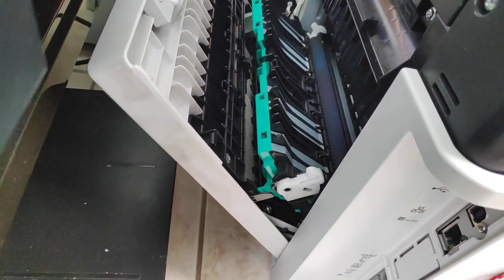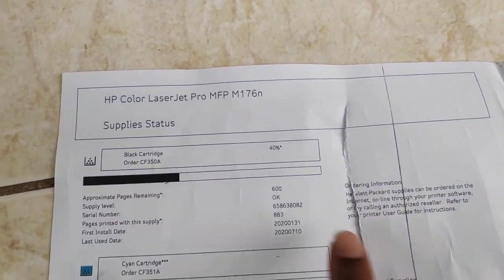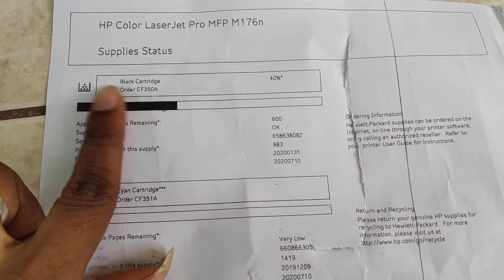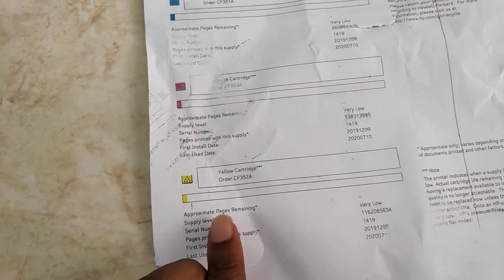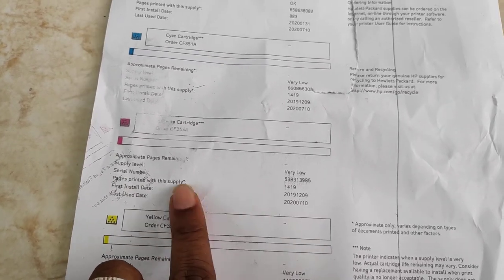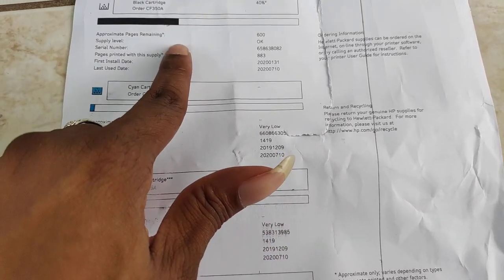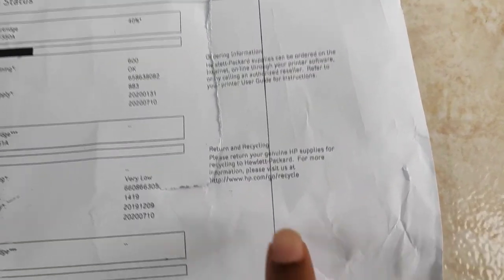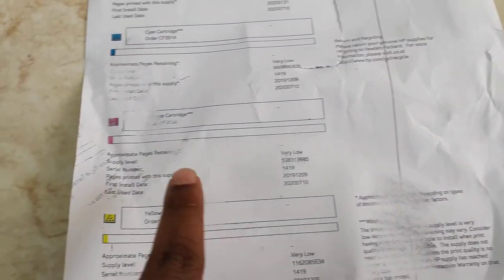You haven't seen the paper here because I didn't press it at the right time — you have to be precise. But I have a piece of paper that already went through the process. This part was in the fuser, as you can see — it's fused. This half was not fused, because if I put my finger on it, the toner comes off. You can see the repetitive mark here. If it had the mark and it didn't reach the fuser, it's coming from one of your cartridges. This part is already fused, and this line is also coming off the toner cartridge.